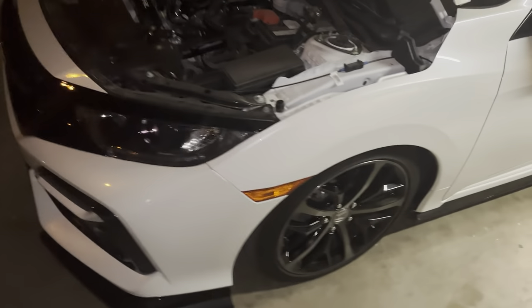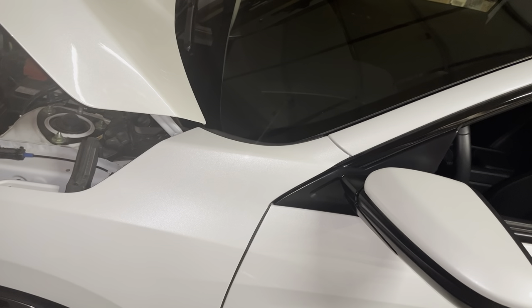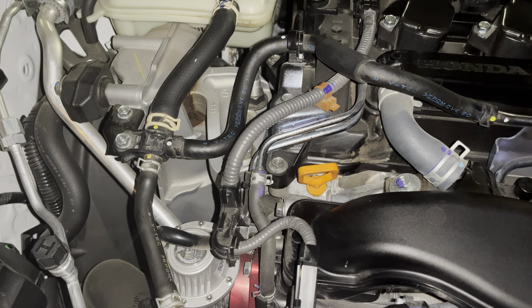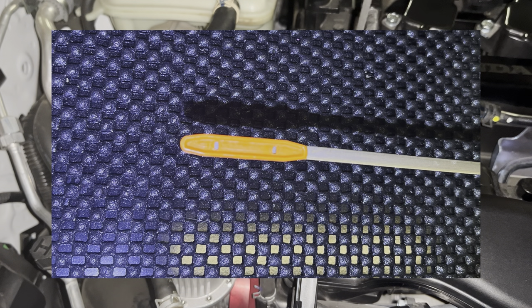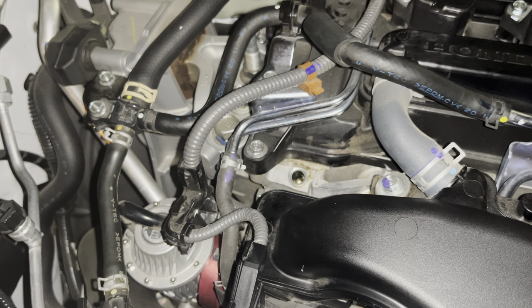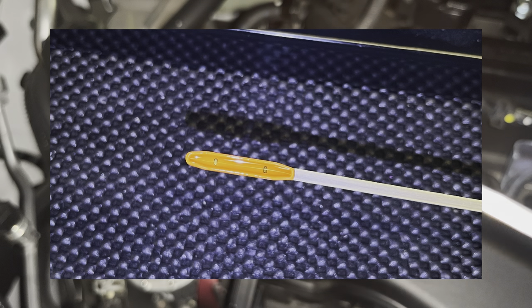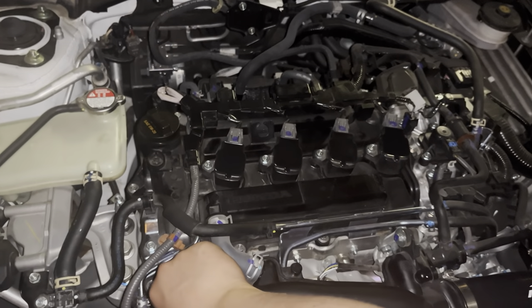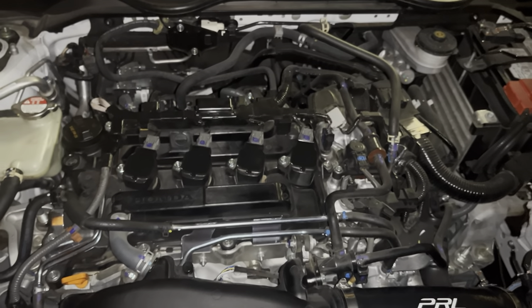Now that we have the car on the floor, start it up and let it run for a couple of minutes so the oil cycles through, then we'll check the oil level and add oil as needed. After running it for a couple of minutes, go ahead and pull your dipstick out, wipe it clean, put it back in, pull it back out, and check where your level is at. You should see oil at that very top dot — make sure your oil is at that second bubble or the very top bubble and everything is good with no leaks.